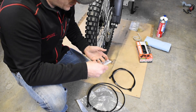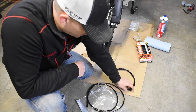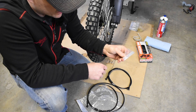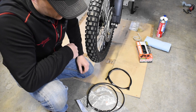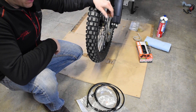The kit comes with some really nice heavy-duty Russell brake lines. You'll have your banjo end here and then your blocking banjo end on this one. It also comes with some brass washers. You want to make sure to replace the washers — don't reuse the ones already on there. Try to keep these as clean as possible; I like to just set them on the plastic and keep them that way until I'm ready to use them.